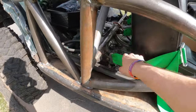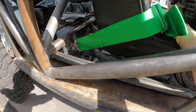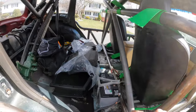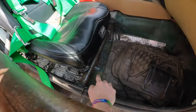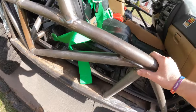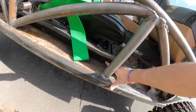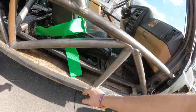And lastly, I have my C brackets done. Did a 50 degree turn into the spreader bar that goes from B pillar to B pillar all the way up to the front here, and then I have this other bar that goes from sill to tunnel, and it's also tied into the unibody. Now that I cut this other sill out, I'm going to come behind this with maybe a quarter inch angle and tie this into this 2x6 as well, to get a little more structural integrity.